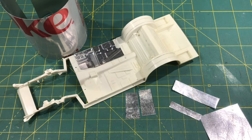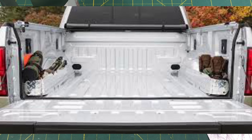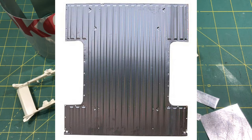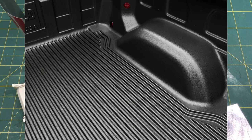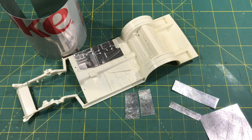To give you an idea how that works: if you look at the bed of a pickup truck, you notice the gauge of the metal doesn't look that thick. But the factory ribs are built right into it. If you were to lay a flat piece of sheet metal of that same gauge across the chassis framework and walk on it, when you weren't on a cross rail it would sink in a bit. But if you walk in the bed of your pickup on the bare metal, with those ridges it is rigid - it doesn't move. A lot of lay-in bed liners are made that way too. So yes, depending on the metal and gauge, it does stiffen and strengthen it.